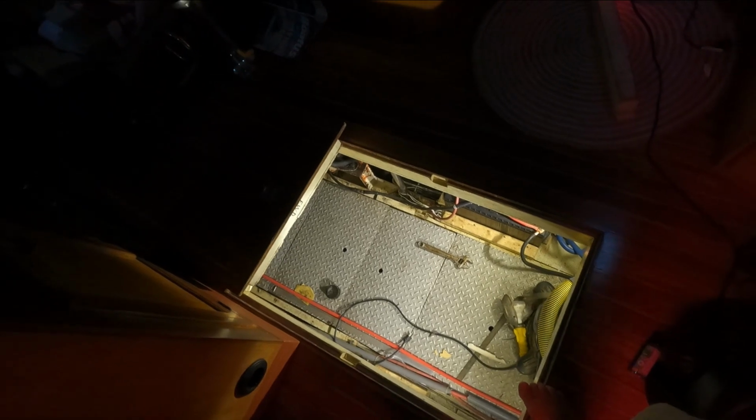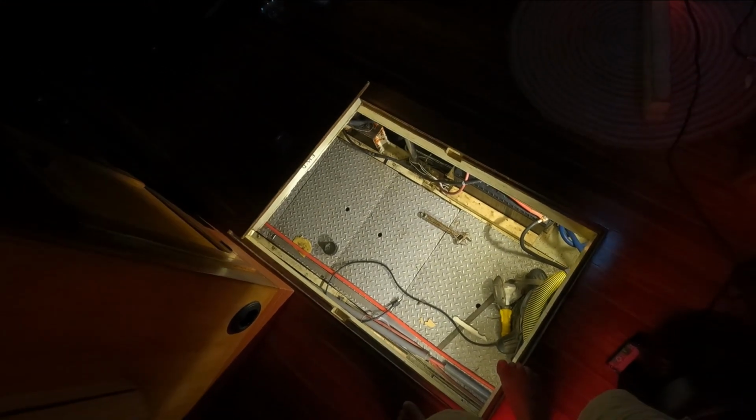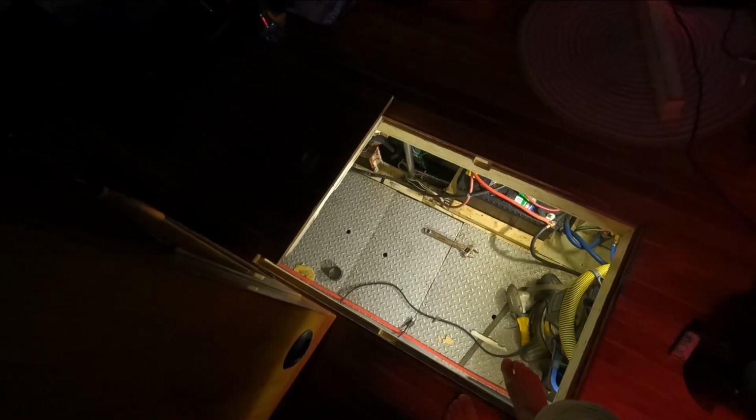I'm gonna put a pressure gauge on the tranny, and we'll go from there. I already checked the fluid level, obviously, and I checked the strainer screen. It was clean, which is good because there's no clutch material stuck in there, nor is the fluid contaminated with clutch dust. I had printed the service manual for the transmission before I left for the trip, just in case I had any issues. So I am going to very simply follow the troubleshooting diagram, see where it brings me.